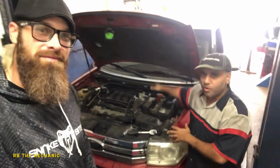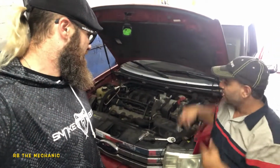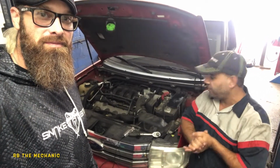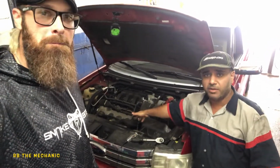So we got this '09 Ford Edge, and we got my boy Bruno in here. He's tall. He's gonna do some kind of wrestling move today. Anyways, this car is overheating. He's gonna help me diagnose this 2009 Ford Edge, and you guys gotta follow along. If you got a Ford Edge, you're gonna check your fuses, and you're gonna diagnose by checking power and ground to the fan. So let's get this job going.